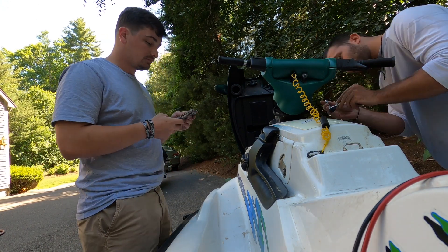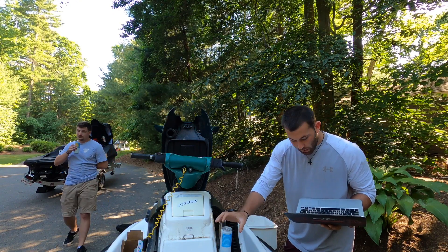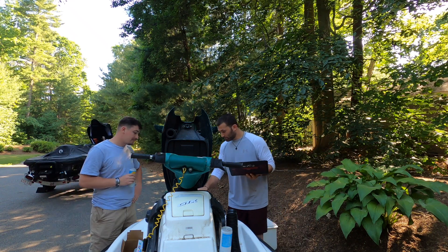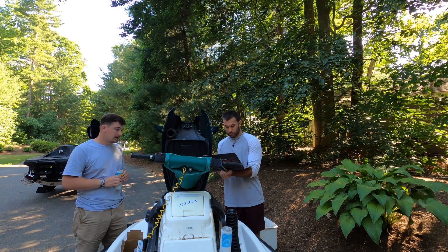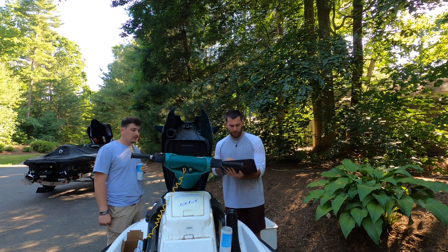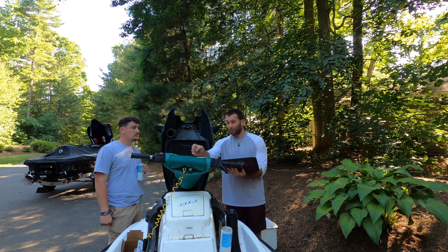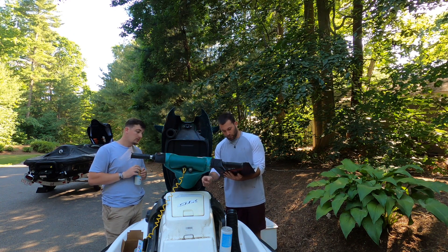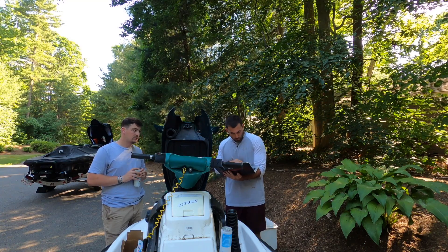So yellow-red all the way to the computer from the solenoid — right. This is, for some reason, labeled yellow-red from the post here at the start button, and then it turns into yellow-black, black.